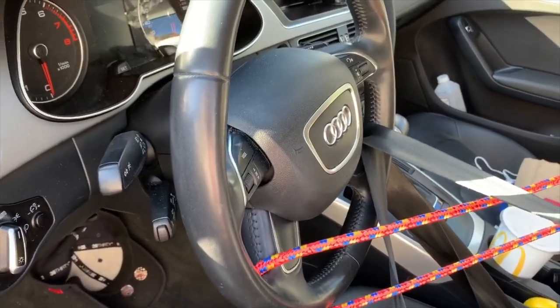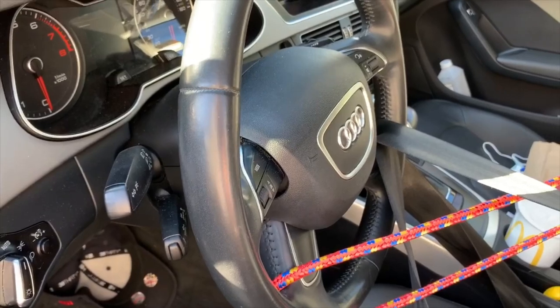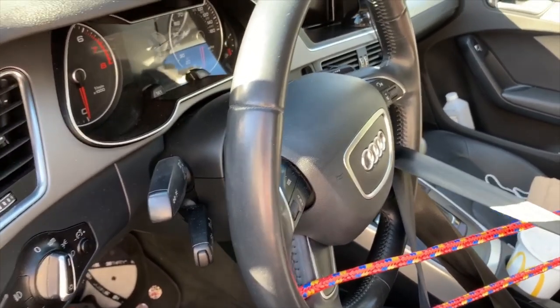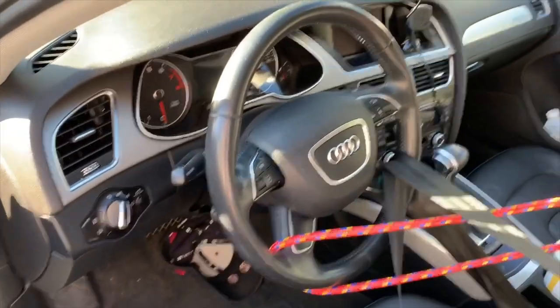There's a spring inside. Your steering wheel rotates, so if it rotates and you connect the steering shaft improperly and you turn the wheel all the way right or left, it'll break and you're going to get an expensive part. So this absolutely has to remain straight.